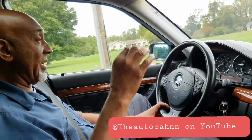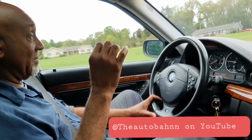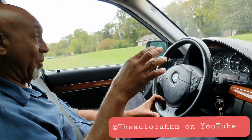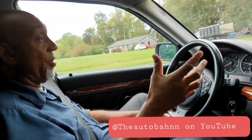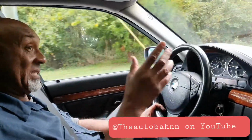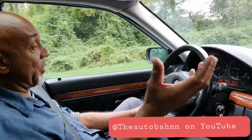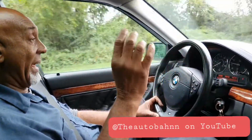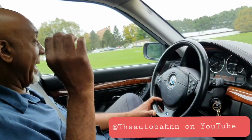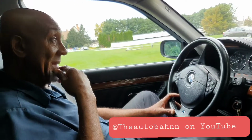Starting to look around, I found a company in Australia called K-Mac, and looking deeper, I saw that ECS sells the bushings. So I ordered some K-Mac bushings that can be adjusted at least an inch more than the normal bushing, the adjustable part of the bushings. Right. So I bought those, and it took me 2 months to get here. When they got here, some of the hardware was missing, but still I made it work, and pressed the bushings into the lower rear control arms, and took it back to align it, and then took it for a ride.